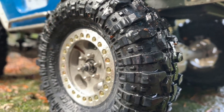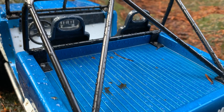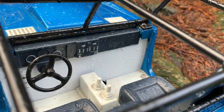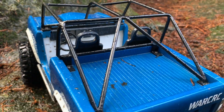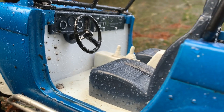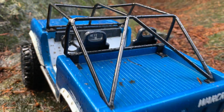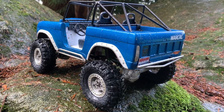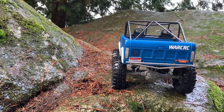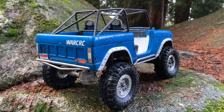What chassis, what axles — what's kind of the base setup platform on this? This is kind of a hodgepodge. It's an SCX10 STRC short wheelbase chassis they produced many years ago. I ended up finding it through a local friend, and that was kind of the final piece that started the build — finding the correct chassis to build off of. Then it was just piece after piece that started to line up. The axles are Vanquish VS410 Origin axles, with the correct driver-side offset differential. The width is pretty much perfect with the fenders trimmed off a little.